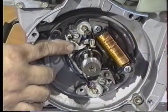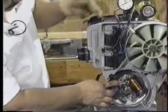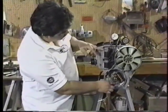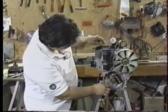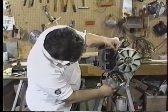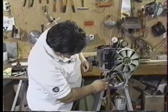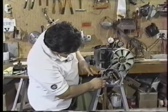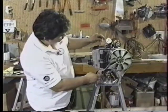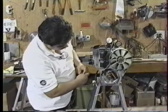This point will take care of the magneto coil, which is for this end of the engine, and this magneto here. The other point will take care of the PTO coil. You can see that the red tracer going here is for this point going to this coil and vice versa for the other one. In our sequence, the points open, the coils have built up energy, and then the points fire the spark plug. That's basically how our ignition system works.